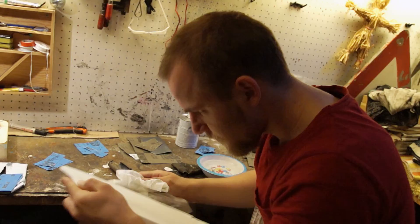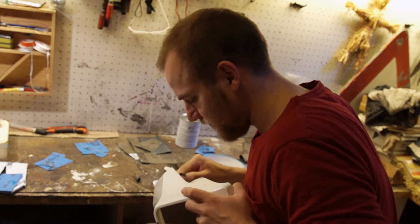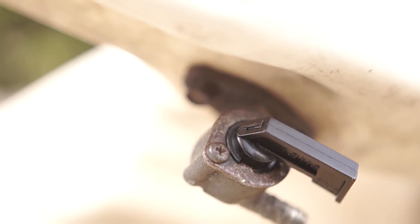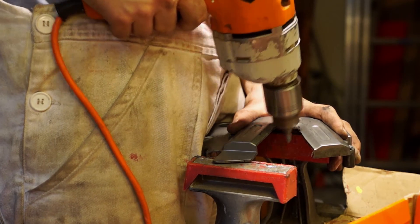I added a different kind of foam on top of the saddle and refreshed the cover as the old one was starting to fall apart. For aesthetics, since I newly owned this bike, I tried to smooth out the scratches in the plastics with a blade and various grits of sandpaper reaching up to 2000. I also refurbished small bits such as the fuel hose guard so that mud can't block the front sprocket, and to simplify sprocket inspection I opened the sprocket cover.